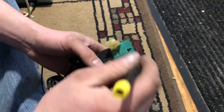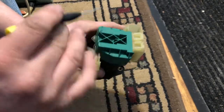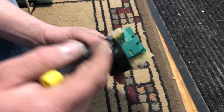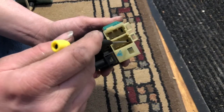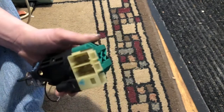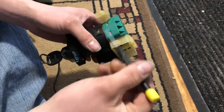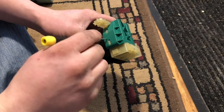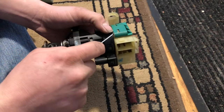We're back on the ignition switch. I'm going to go ahead and see if I can pop it apart - I believe it's this back green piece to get to the contacts. I checked it with the multimeter, everything seems okay, nothing's jumping out, but I did have that one issue with the one pin where there's a higher resistance. It shouldn't affect it, but maybe it is.